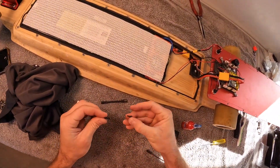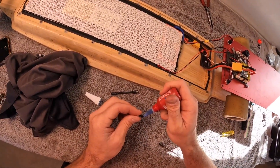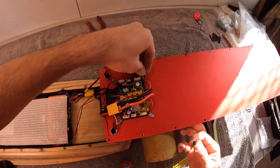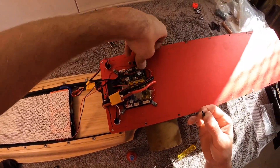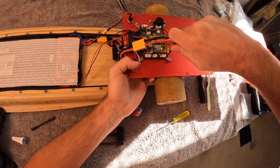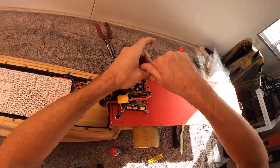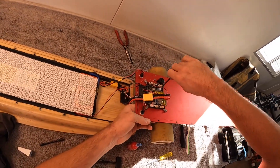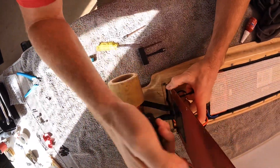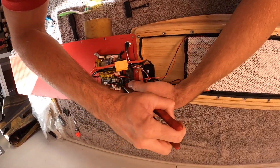Apply some loctite to the end of the screw — may as well do two screws. Put them back in position and screw them in by hand, hand tight. I cannot stress this more: do not over tighten these screws. You'll strip the thread on the heat sink and you'll have to replace the heat sink. So we're going to remove these brackets ready to replace them. This is what happens when you ride with these things loose — it cracks the bracket, which is not ideal.